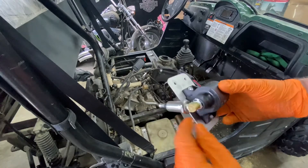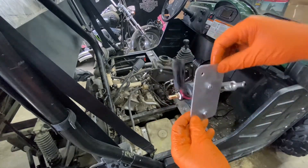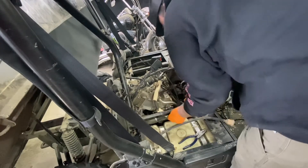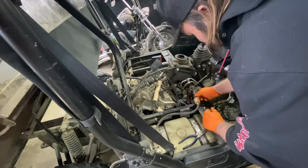We've got our fuel pump mounted to our plate — here's what it should look like. Put a little liquid thread sealer on all your fittings when you're tying it together, and it's gonna mount to the frame like this. Now we're gonna take the fuel line from our carburetor and hook it onto the back side of our pump, and the one coming out of our tank is gonna go to our filter on the pump.